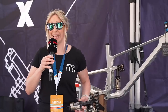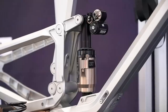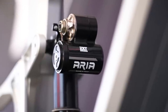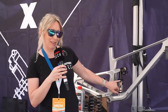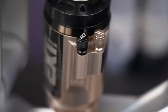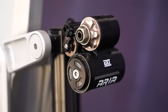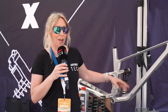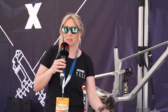At the EXT tent, famous for coil, they've brought out an air shock — the Aria. What's really interesting is it has a dual positive chamber. You can see there are two valves on this shock, one of which you can load up to replace the need to open up and put tokens in. It's going to be a super adjustable way to deal with that on the fly, and I'd imagine it's going to be super buttery, just like their coil versions.